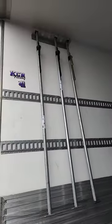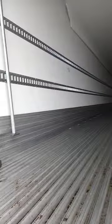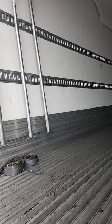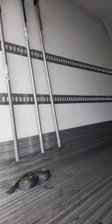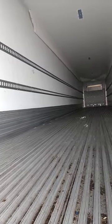I did this by myself, so you've got to take a bunch of load bars and put them across at the height where you need them. As you go through, adjust them to get your height right. Take a little hammer and tap them up or down — just get them close. Then put your e-track on top of the load bars. I picked the e-track up when it was in the trailer, put the load bar underneath, set it on top, and kept working my way back.